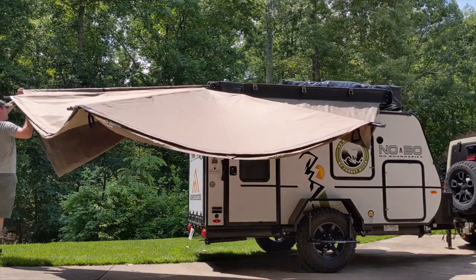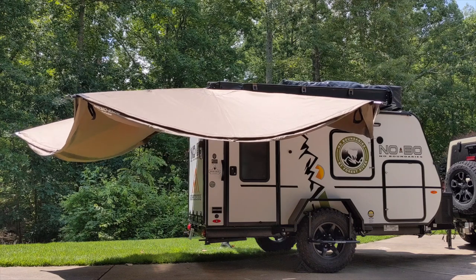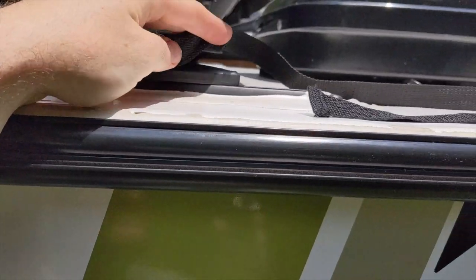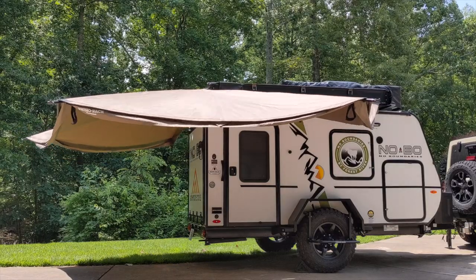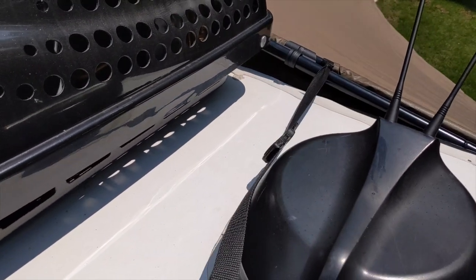Just a reminder: avoid setting up the awning in windy conditions to avoid damage. When it's unfolded completely, you'll secure the awning using the nylon strap and tether located just under the pioneer roof rack as shown here. Then pull the strap to ensure the awning is secured tightly. Notice how it fits right between the AC shroud and TV antenna.